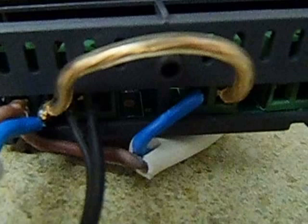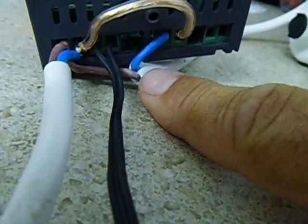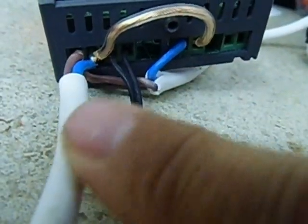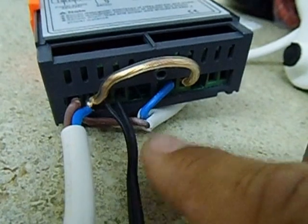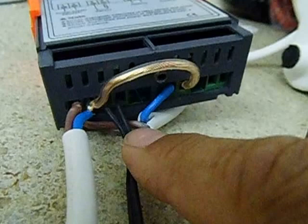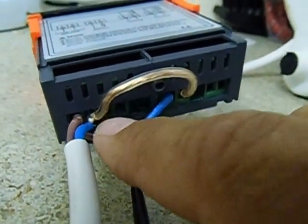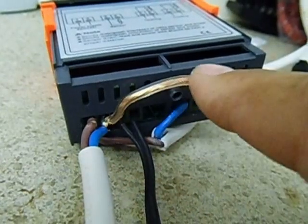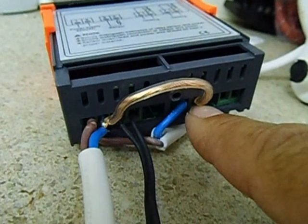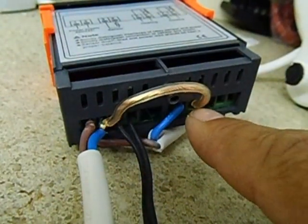So one is your active live power wire, which is your positive, and that joins up exactly with the fan. These two wires come directly from the plug. The positive is common, so both the fan and plug wire go into number one. Number two comes from the plug and goes into number two, next to the positive. That will run through this wire to number six, which is the heating relay — so it comes from the negative and runs to number six, which is negative.